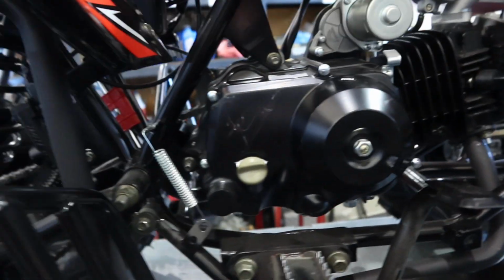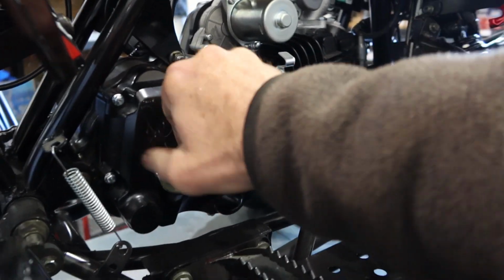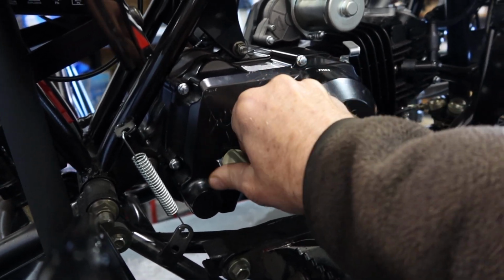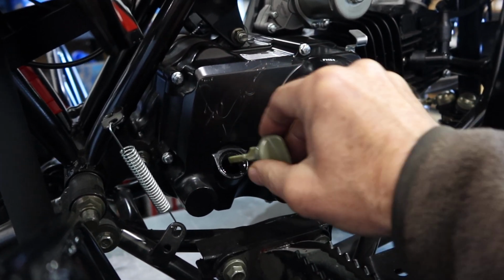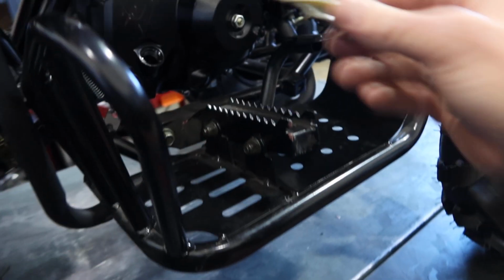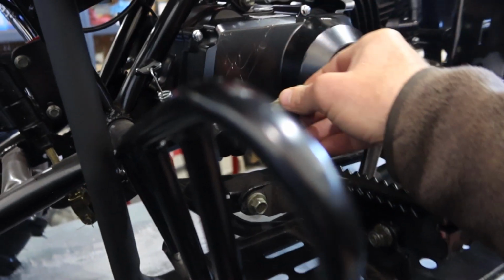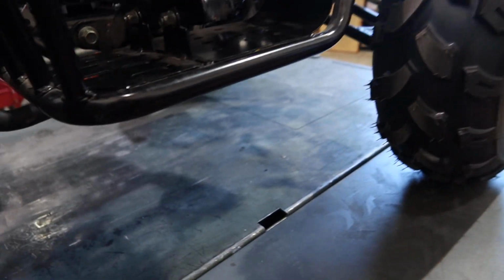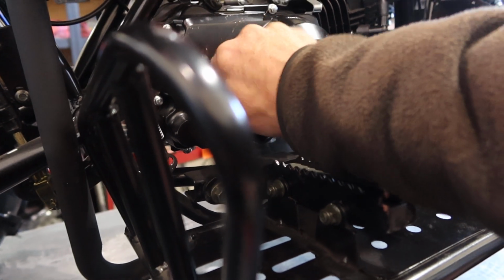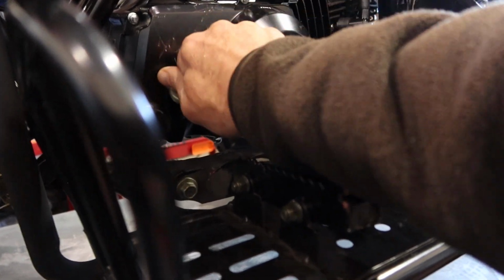This is your oil check on this side, you guys. It takes just shy of a quart of oil. Always use high-grade oil. Don't be cheap with the oil, you guys. You could unscrew this lightly, check it there at the hash mark, you wipe it down nicely, you double check it by dipping it in, and to check it, make sure it's nice and accurate. Again, it takes just shy of a quart of oil. You don't want to fill it over that hash mark line.